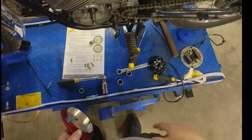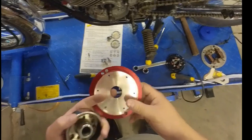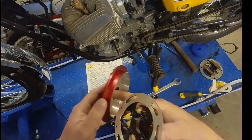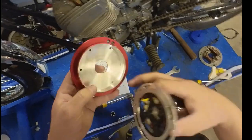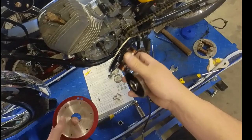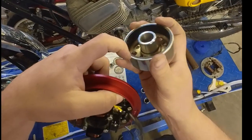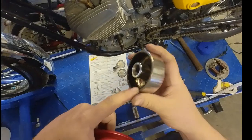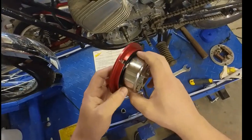So welcome back - it's actually been a couple of weeks because we had to modify pretty much everything on this ignition to make this thing fit. What we did: a friend of mine turned the base plate down on the lathe so there's actually a lot removed there. We also removed one millimeter of the stator plate, and there used to be a little lip on the middle part of the rotor - that has now also been removed, so that's also one millimeter less. Hopefully this thing should fit now, let's try to fit it and see what we get.